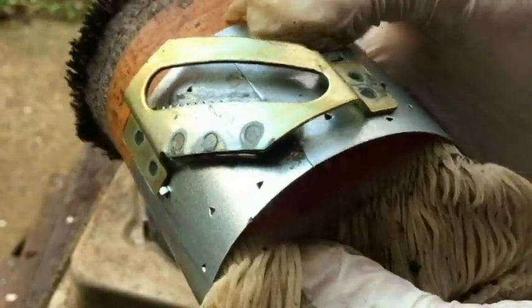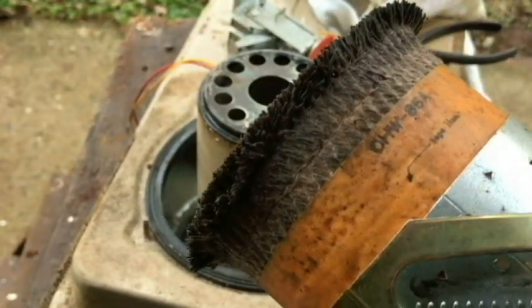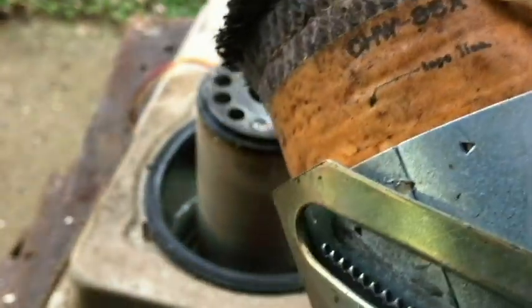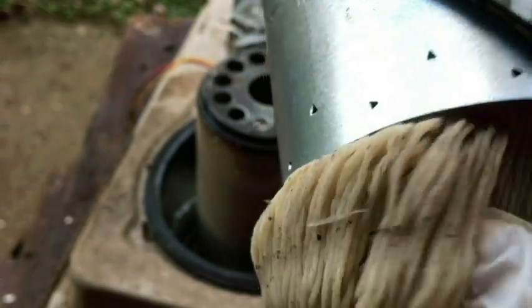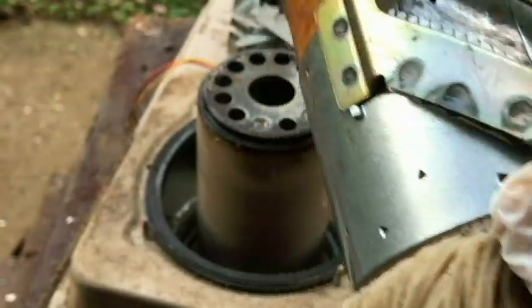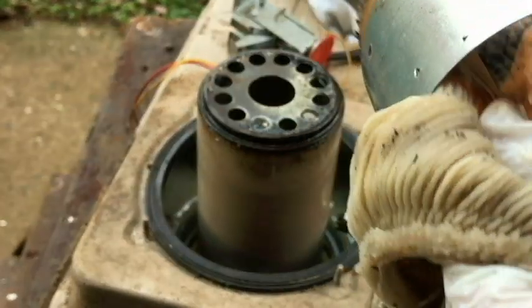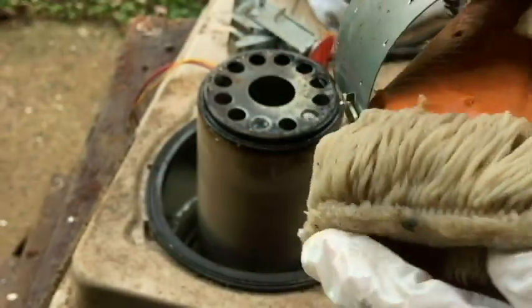There's a tape line — there's an arrow. This is the old wick. Hoping the new one is going to have the same line. But there is a line right there, so that'll be the top. You can see where this starts flaring out here at the bottom — it goes into the tank and it's kind of lined up at the bottom right there, just in case the new one doesn't have lines that we need. Inside the wick holder.